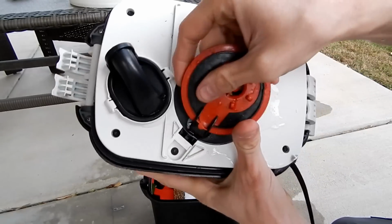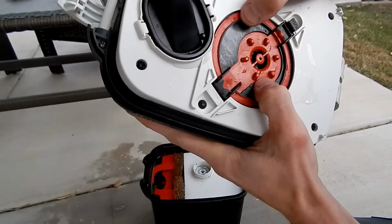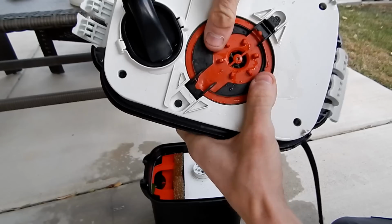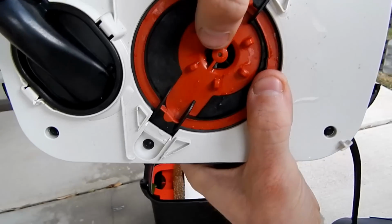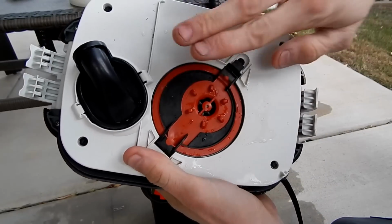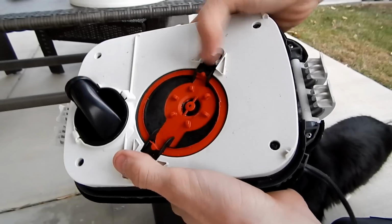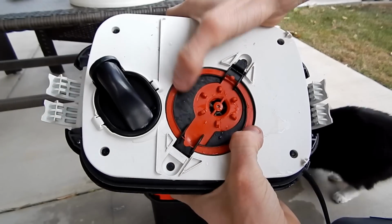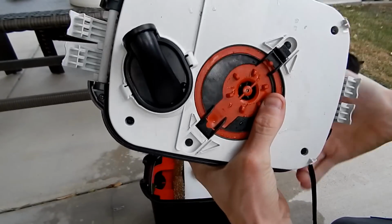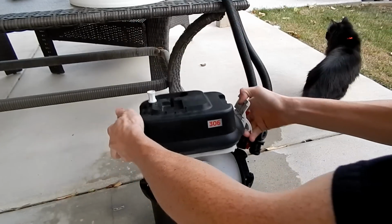The impeller cover, when you put it on, make sure that this side and this side are recessed all the way down so your ceramic shaft does pop through the little hole. I've seen a lot of these where it's curved a little bit because all people do is click this part in, but the top or the sides don't get recessed and it doesn't make a good connection. So, over explaining everything, but that's alright.